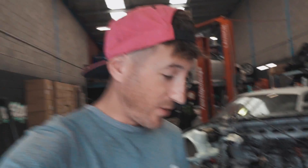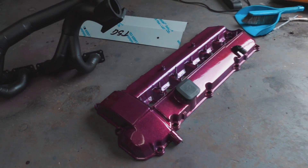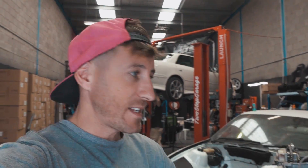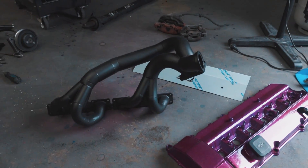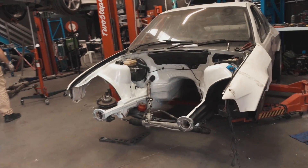We're back and our valve cover is dry and it looks freaking awesome - very sparkly. The clear did shrink back a little bit as it does, so what I'll do is a flow coat - give it a nice fine wet sand with 2000 grit and then do another thick clear coat, let it dry again, and it should look really really shiny. That also just flattens out some of the imperfections. Even as it stands it looks freaking rad, especially next to the matte black turbo manifold.